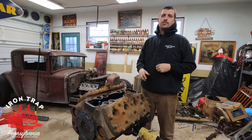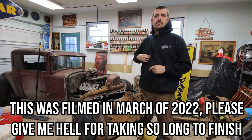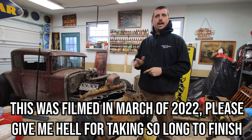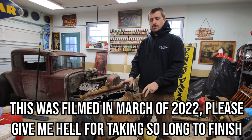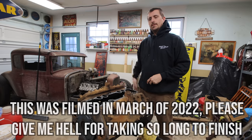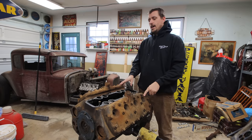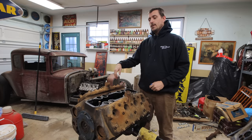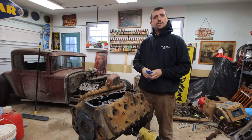So the last episode you saw, I did a compression test and tore some things apart just to see what it looked like. There were a bunch of comments. I've never done a compression test on an engine that's been sitting for so long. A few people commented to squirt some oil into the cylinders. So I have very high confidence that this engine has really good compression, as a few of the cylinders had probably 110 pounds of compression.